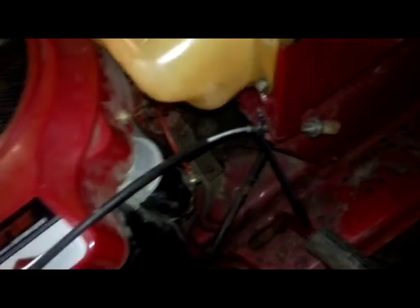Hopefully this thing will start for you. Put my choke on — my choke's down there now. It's not that loud, but it's kind of loud. I gotta mess with the choke. I think the carburetor needs cleaned out because it only runs on choke. But it runs good on choke. We got the choke all wired up — just putting it right there because it's not long enough, but it'll clear the hood.